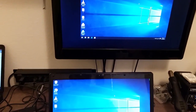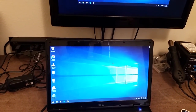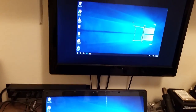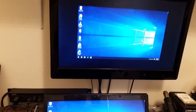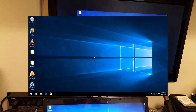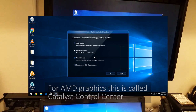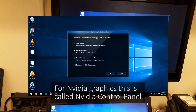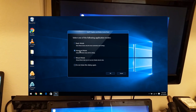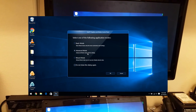The computer detected the television and by default it's cloning what's on the main display on the laptop to the television. I'm going to right-click on the desktop and go into graphics properties. This is an Intel graphics chip, so if you have an Intel graphics chip in your laptop or regular computer, it will look very similar to this. I'm going to choose advanced mode because it gives me all the settings, as opposed to basic which doesn't show you everything.